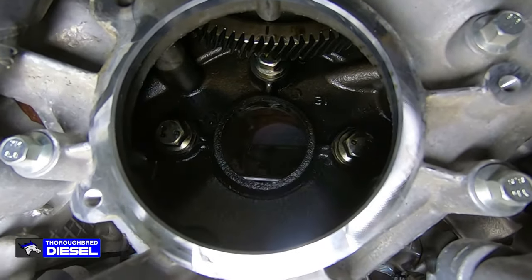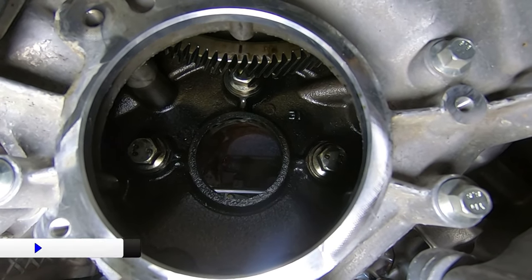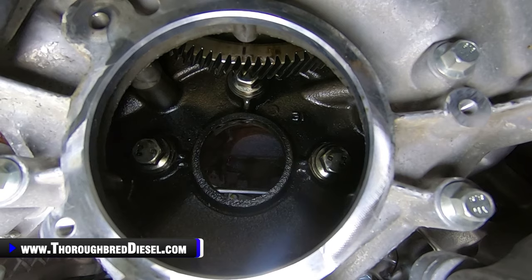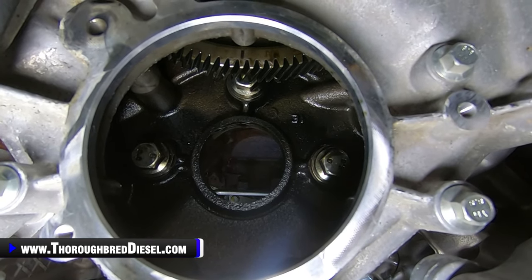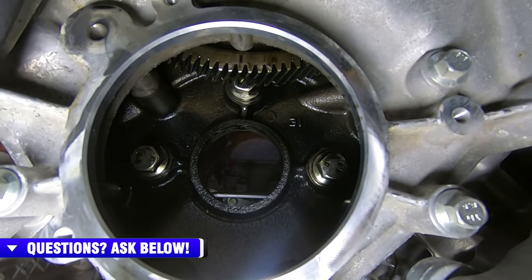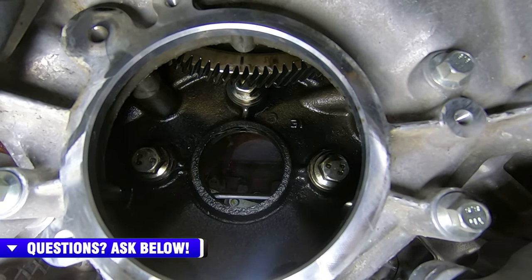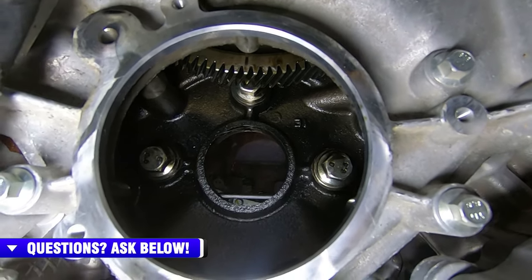Again, get in there with a quarter inch drive socket and loosen the bolts back, and they'll just barely come by that timing case. You may have to put a little bit of pressure towards the inboard side there, and the bolts will come right out. So we're going to go ahead and remove those now, and I'll set the GoPro up and try to show you that as I work on it.